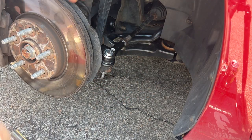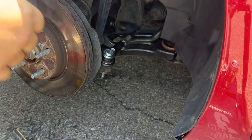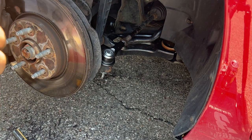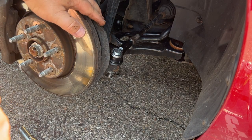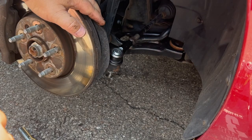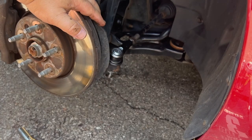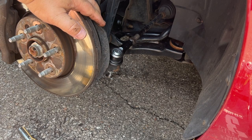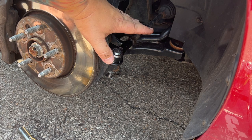That's it — it's done. It's that simple, and now we're tight. The last step: once you get the car back together, you may have to do an alignment. There's a home alignment tool which really isn't that difficult to use. Quick and easy fix — about 20 minutes to change the tie rod end. I do recommend if you change one side, go ahead and change the other side too.